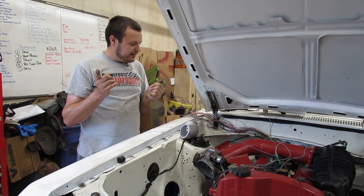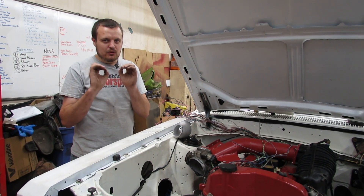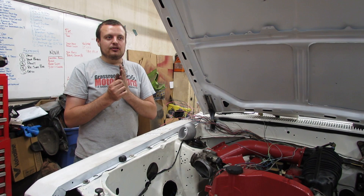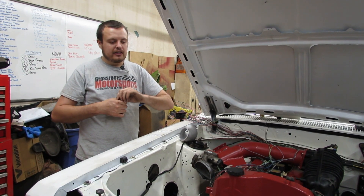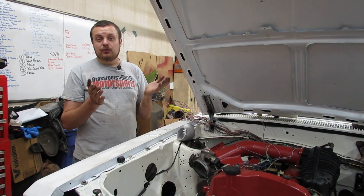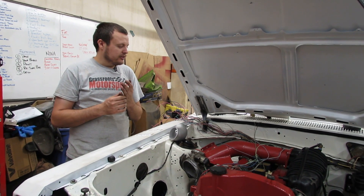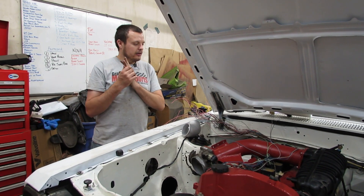It's a bunch of wires and they're all very simple systems. You just have to route them all to where the computer can get to them and manipulate them in the way that you want. You just have to look up the data or read forums. If you're doing something more one-off like a Mitsubishi, there may not be as much good information out there. But if you're working with GMs, most of the information is very easy to find, and most stand-alone systems use GM sensors. If I have a chance to use a GM sensor, I use a GM sensor. I'm going to get to work on labeling all of these wires, tracing them back, and then loom the thing and get it wired up.